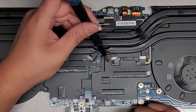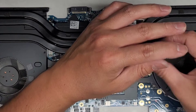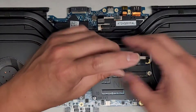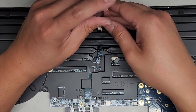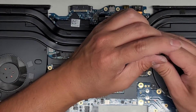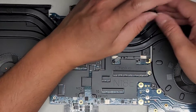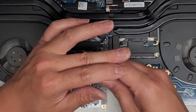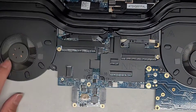Then we got the last ones, 9 and 10. Twist it backwards, then one, two, three, and again one, two, three, tighten it all the way. These things are somewhat spring-loaded, so they will be constantly putting pressure pulling it down until it's completely flat, so you don't need to worry too much. There we go — we got the heat sink remounted.